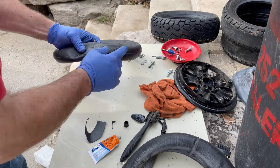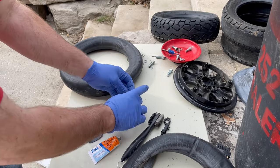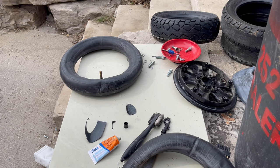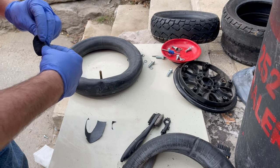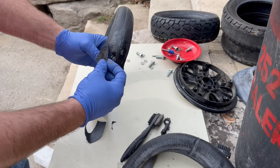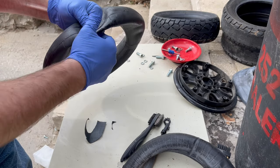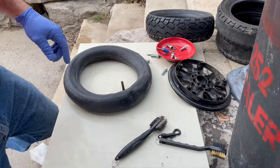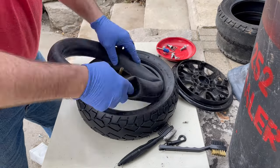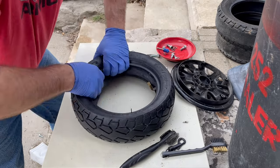Ideally, what you want to do is put the glue on in an even coat, and then let it dry until it turns white, and then put them together — ideally in a press. There are some really crazy methods that people use to get these patches to dry faster. Some guys catch them on fire — they'll put the inner tube on fire, or put the patch on fire, and then slap the patch on top of the inner tube and put it in a press to hold it. I've seen it work, but I don't ever suggest doing something like that.